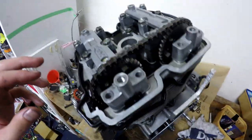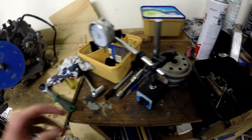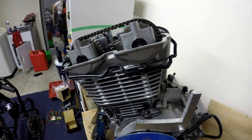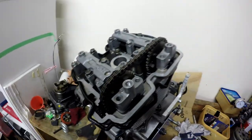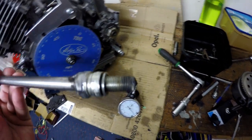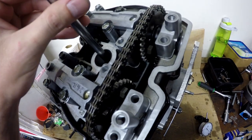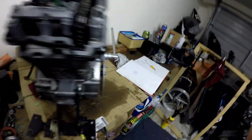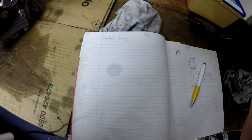After a bit of tinkering we finally got this ready to check our cam timing. I had to put the rotor on temporarily because the timing mark is on there. We'll slot the sprockets once we've figured out where we need to move the cams to get optimum cam timing for this motor. I've fabricated a support using a Harley Davidson push rod with a spark plug for this motor welded to the end — we'll screw that in and use it as a support for our dial gauge, set on zero, and when we rotate the motor we'll figure out when the exhaust just starts to open.